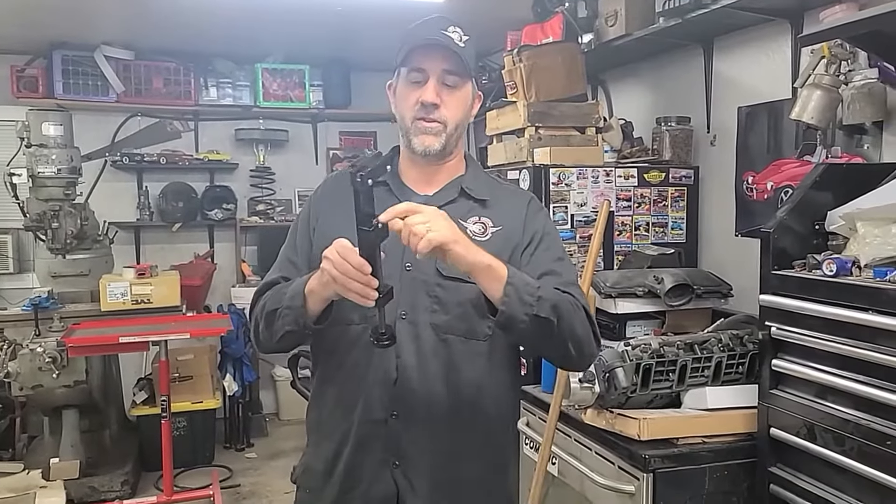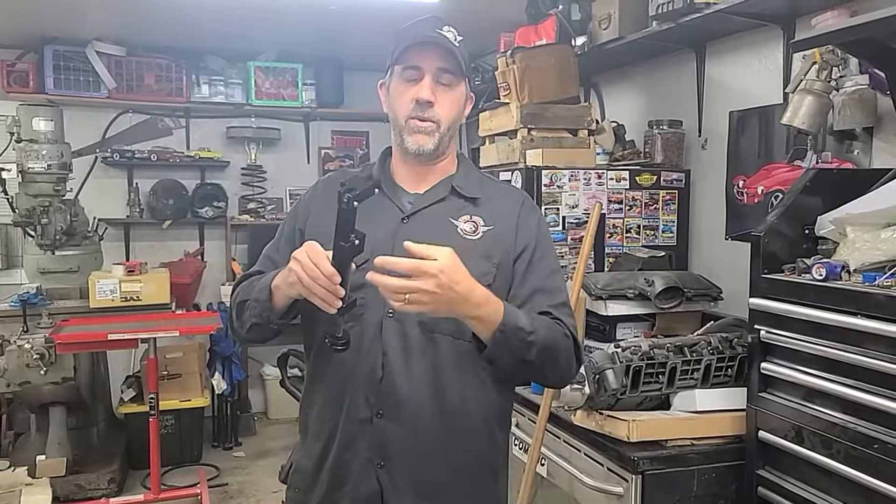What we're going to do now is cut open the oil filter using this oil filter cutting tool. That way we can pull the filter out and look inside to see if it has any metal in it. If it has metal, we know it's chewing up bearings and the engine's probably not good. You can also see how sludgy it is and if it has any water in it, so it'll really tell us what this engine looks like inside.